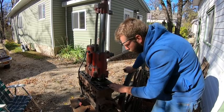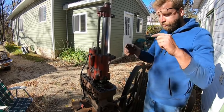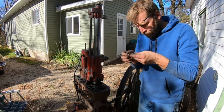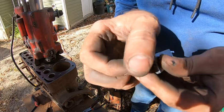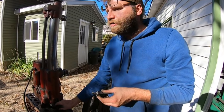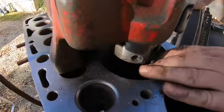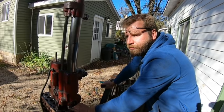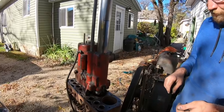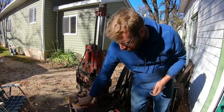Okay, that was actually a very nice finish. The only issue is as it went through where the unworn part is — where the ring made its groove at the top of the ring land — I don't know if you saw it but it jumped a bit and literally just chipped about one or two thou off the edge of my cutter. I set it at 9.02 and it's actually about 8.98 — you can just feel just a hair bit of a lip there. But a sure nice finish. Especially for a finish leave — three or four thou for honing — that would be just perfect, as long as it's round and straight. That's the key. Be nice to finish you want, but if it ain't round and straight it ain't gonna do no bloody good. We'll reset the cutter and take one more cut — I'll set it again for 9.02, maybe even 9.03. Living on the edge a bit.